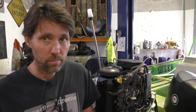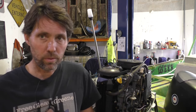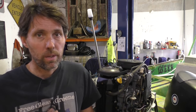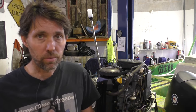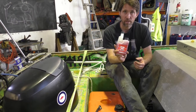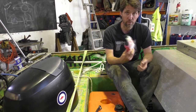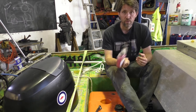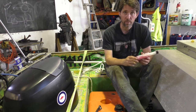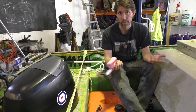What I'm going to do is add it now because I want to go for this final run still. I want to make sure that when I put the boat away, all the fuel in the fuel filter, the bulb, and the fuel lines all has fuel in it that's been treated. If I add this after the last run, it'll only be in the fuel in the tank itself. Products like Stabil are designed to preserve fuel and stop it going off during the period you're not using it — the packet says it'll do up to 24 months and it's safe for four-stroke and two-stroke. If you add this before your last run, it recommends running for about five minutes to make sure it's treating the whole system.